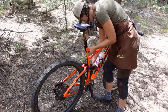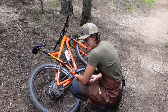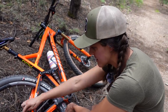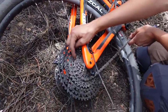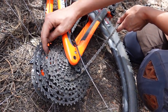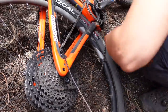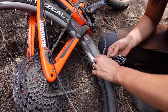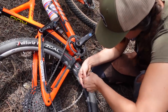Let's see how we did — we're going to lock this out. Okay and it's falling off. Well, that was unsuccessful. I think our error was that the bike was not actually flat when I decided it was a straight enough chain line. As soon as Mackie got on it, it dropped down to a different gear. So we're going to shorten it again. That's actually a useful way to test it — get on the bike and ride, and if it shifts into a harder gear you probably have to shorten it again, because that's the straightest chain line and it's always going to go for its straightest chain line.